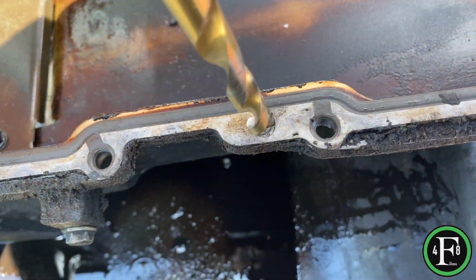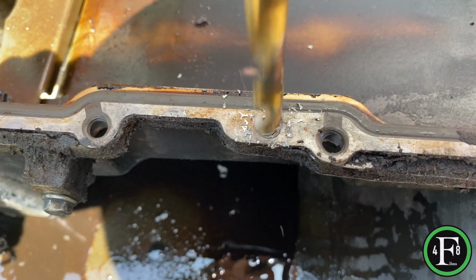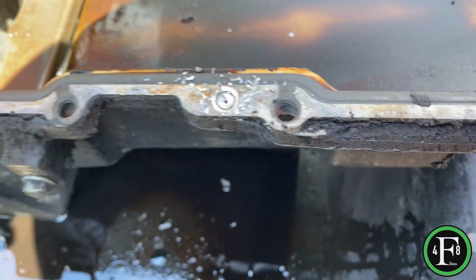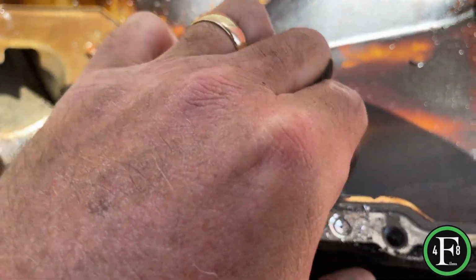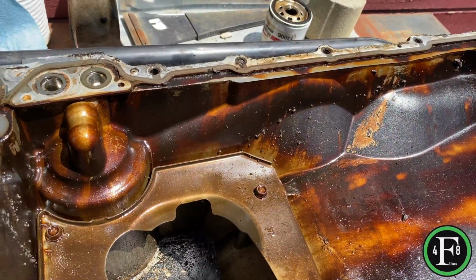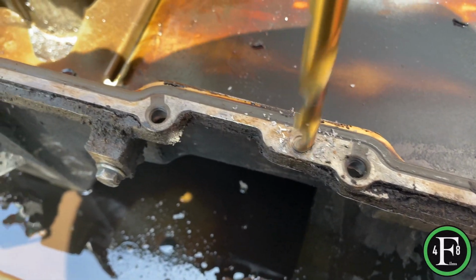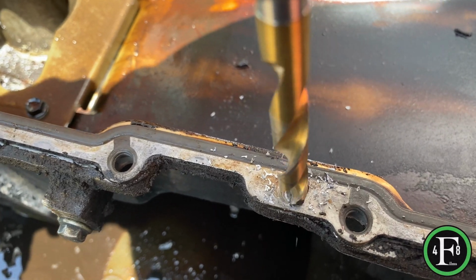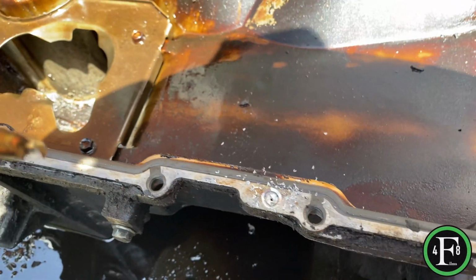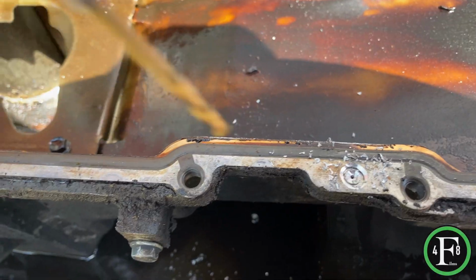There, it broke free. I could feel it start to spin. Let's get my hands on this. Oh, my bad. No spin yet. So let's do this. Oh, I see what's going on. The actual rivet is spinning. So I think I'm gonna try and sink it right through the middle with a smaller bit. Let's see if I can get set up for that. This thing just started spinning, obviously too.